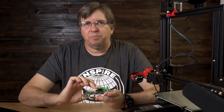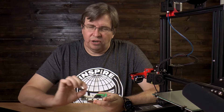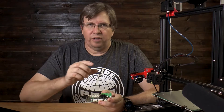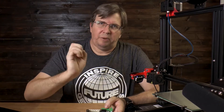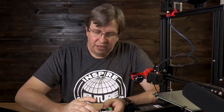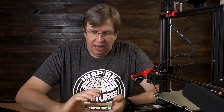The BTT board is ready to print out of the box — it's a one-for-one swap. What I like to do is unplug each connector from the old board and plug it directly into the new board, so I don't get the wiring wrong. You can also mark your cables with masking tape or labels to map everything out. I just took care of the screw-in terminals, made notes of what was where, and everything was properly wired up.